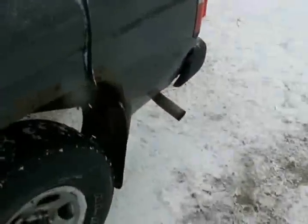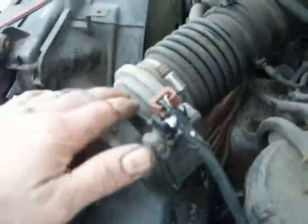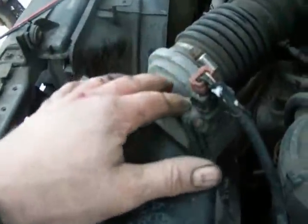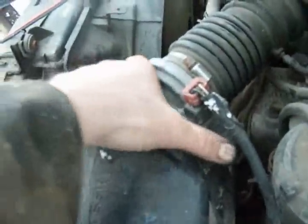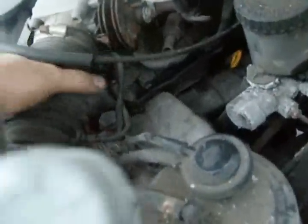The fuel leak was part of the problem — you can see it's still missing. You hear a sucking noise under the hood here. There's something like a MAP sensor — I'm not sure what Nissan calls it, air intake valve sensor or whatever — but you can hear it hissing. These hoses get cracked over time and it'll run like crap. I can hear the pitch change — I'm betting there's a crack underneath here somewhere. If I can find it I'll tape it up. It's definitely got a vacuum leak.